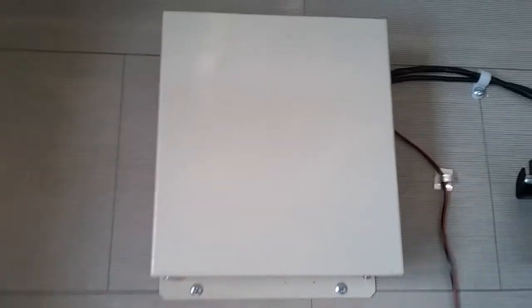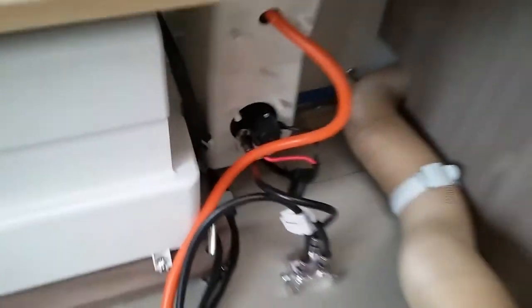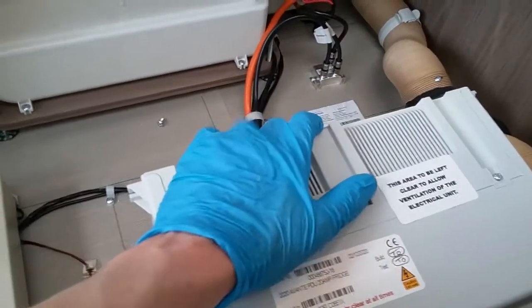If we now move across to the bench seat and remove the cushions, you will see that we have storage beneath. We have the alarm box just there, and we also have the back of the battery box. You can see where all of the aerials plug in at the junction box just there. We then have the main 12 volt fuse just here, and the consumer unit just here, with the battery charger at the back.